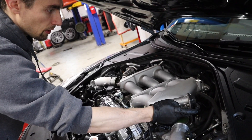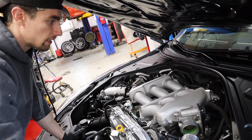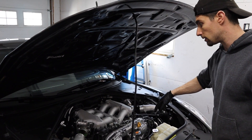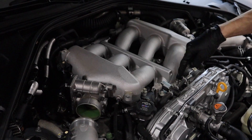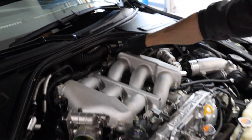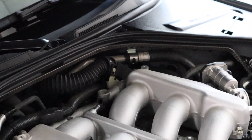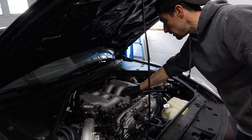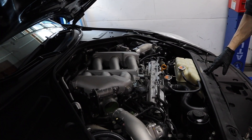We're going to disconnect the throttle bodies next. There are a couple of other vacuum lines behind and the 10 millimeters in the middle, wiring in the back, and it should come right out. We have all of the miscellaneous hoses and wires disconnected from the manifold — there's really not much on here. Now there are a couple of 10 millimeter bolts right there in the center. Manifold should come right out. Push the wiring down first, push the tab in and it comes right up. We're going to remove the rest of the bolts, pull the manifold off, and then the fuel rail will be right there. We're going to take our time and move it out slowly.